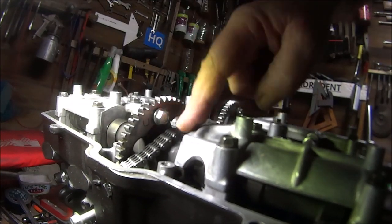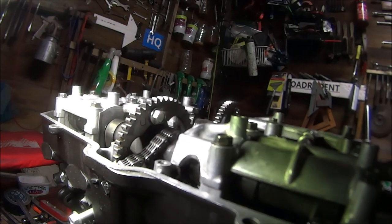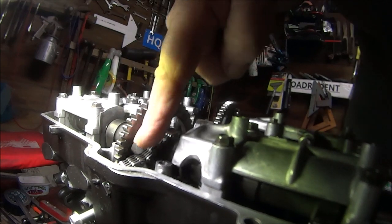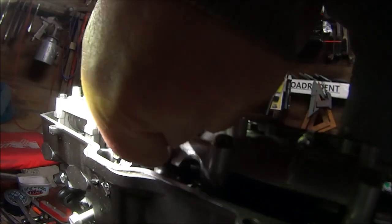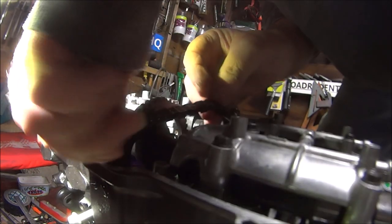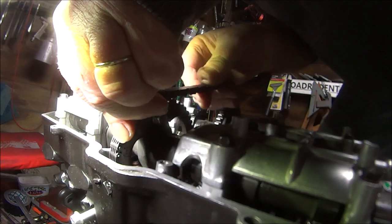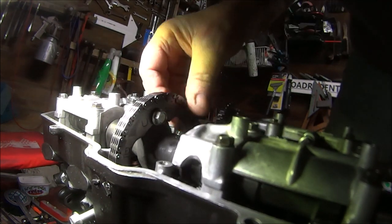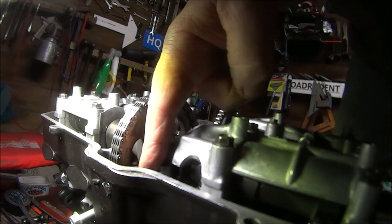Get to the chopper! Right then, from the front of the engine first, we need to get the cam chain onto the first sprocket. And obviously get rid of all the slack of the chain, what's down the other end. So, pull it tight as you can, and then hook it onto the first sprocket, the exhaust sprocket. Try not to have any slack down there whatsoever.